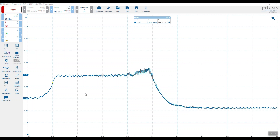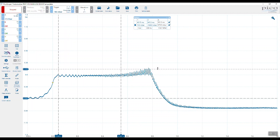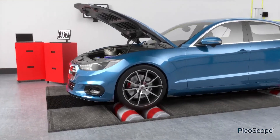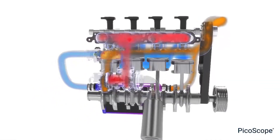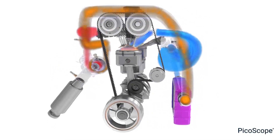Atmospheric pressure remains in the intake manifold for quite some time. Looking at the distance from this point to before we start increasing above atmospheric, we've got 500 milliseconds. We do achieve a little bit of boost pressure, but not what we saw on the good vehicle where we came up much higher — about 0.5 bar. Attaching the pressure transducer to the inlet manifold allows you to capture turbocharger operation and performance across the entire engine speed and engine load range.